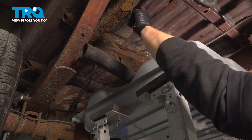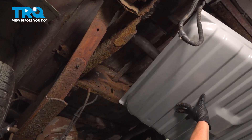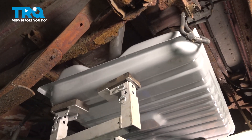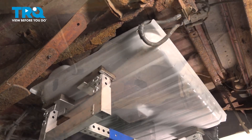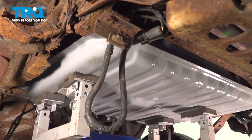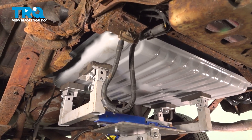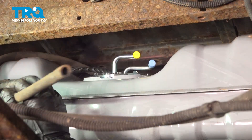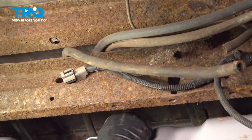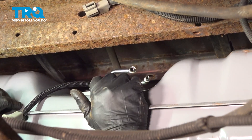We have to get this filler neck hose up over that frame. The tank is empty now, so it's pretty light. I've got that filler neck coming right through there. I'm going to jack it up, then tilt it forward so I can drop it again a little bit and get to the fuel pump lines. Now I'm going to take the vent hose and bring that right back over this top frame bar. I've got my two fuel lines here — the smaller one is on the bottom, the larger one is on top, and that's the blue one.